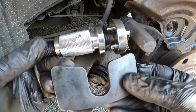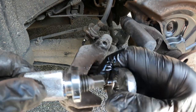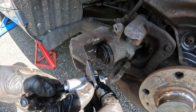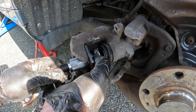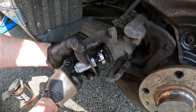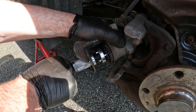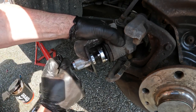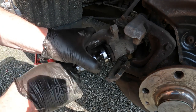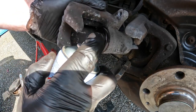Here's the tool for pushing the caliper piston back in - it was a pretty cheap one, only got this one adapter with different spacings. We slowly wind in this caliper piston. As I did earlier, I released the brake fluid reservoir cap to allow the brake fluid to rise as it needs to. And that's all the way in. A little bit of brake cleaner just to wash off any WD40 - we'll let that evaporate.